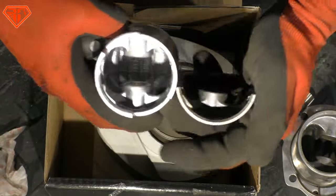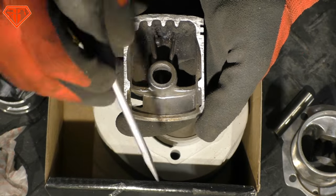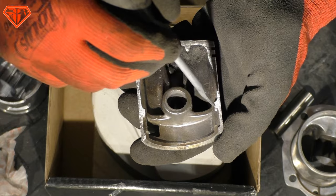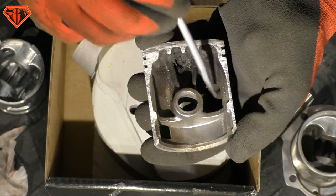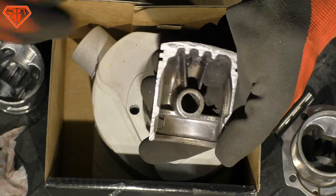Nice. Biggest impact is here, the piston pin, the conrod, the crankshaft is here. Just pushing and pulling massively. So the force impact here has to be put evenly into the skirt in the whole piston. Means you need these four beams. It's not important how much hold you have. It's important that it is stable statically.